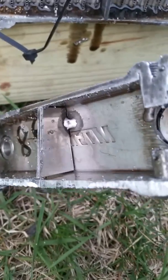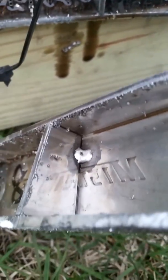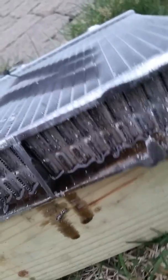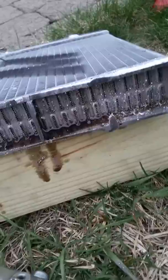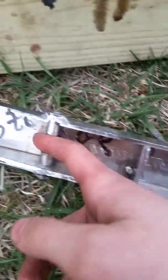You guys can see that gap — it's every bit of a 16th of an inch all the way around. Just the one side where it's actually sitting on it, it's closer to zero, but it's still got a few thou. So yeah, don't buy this. Oil temps barely dropped anything — I was wondering why. It's because it's all flowing in the inlet, right through here, and out the outlet.